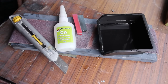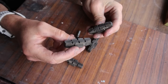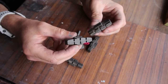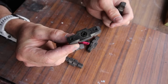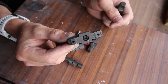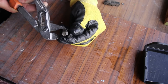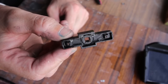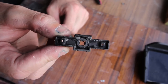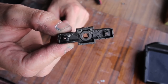Now that we've got the tools covered, let's move on to the pad blanks and materials. We're not going to make an entirely new pad from scratch — we're just replacing the braking material, so we'll need some donor pads to work on. They could be cheap new pads or worn down old ones; it doesn't really matter as long as the backing works. With the plastic backings, we're actually going to leave the original material in. If you did want to remove it, leaving the pad in boiling water will weaken the glue, allowing you to pull it out. The reason I leave the original material in is because the backing has quite complex shapes inside, which will be extremely difficult to cut into the new material.